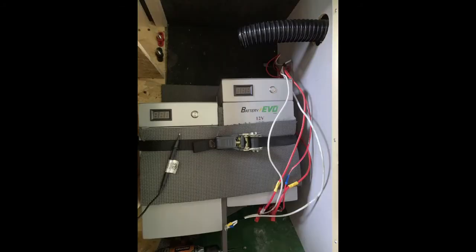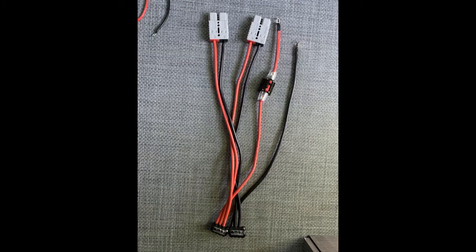The lithium batteries are pretty much plug and play. I have my positive and negative battery terminals screwed into the CDX plywood, which is really thick — two layers. I got two cargo loops at Harbor Freight, screwed stainless steel loops on either side of each battery, and I'm using a ratchet strap so I can easily take them out. The batteries are sitting on foam — those interlocking foot mats from Harbor Freight — with padding on the bottom, in between, and over the top.